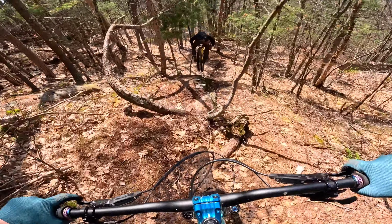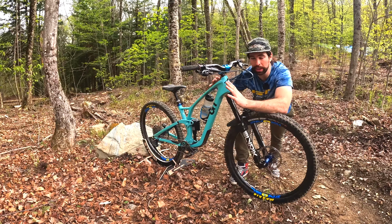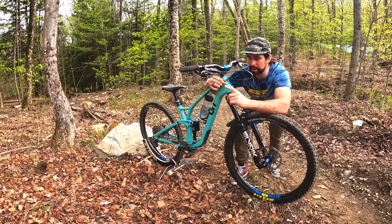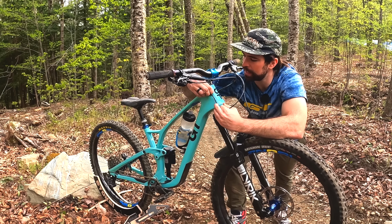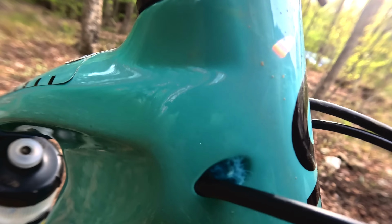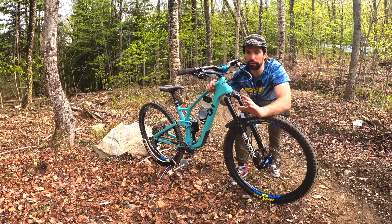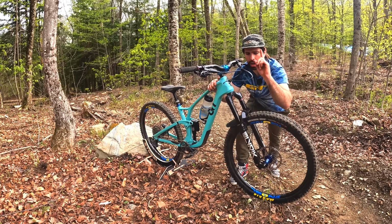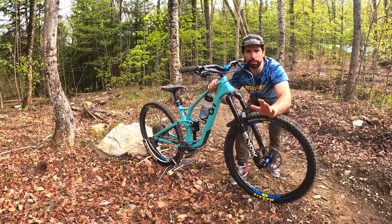On my brakes, I have a little trick to silence cable routing. With internal cable routing, it minimizes cable rattle, but it still exists. It still rattles inside internal routing. So I've started adding these little pipe cleaners to deaden any vibrations, and it's made a huge difference in terms of how much noise my bike produces. I figured I'd mention that because it's one of the few tricks that I've never seen mentioned anywhere else.